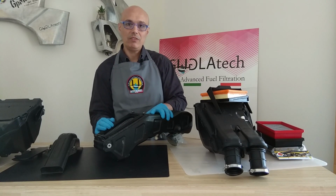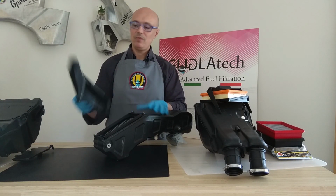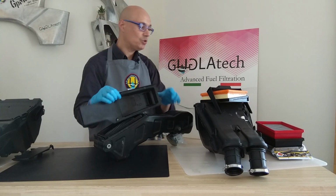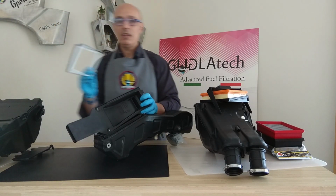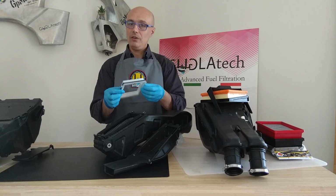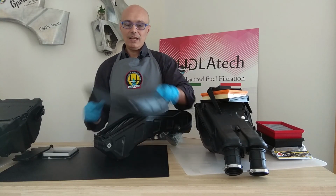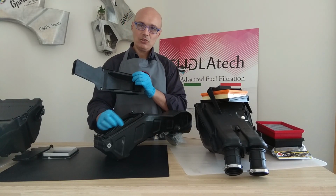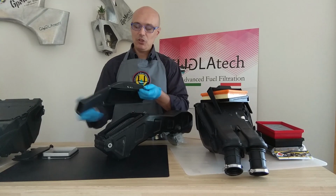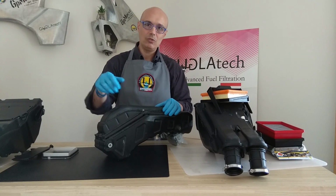One airbox may be with the defect, another airbox may not have the defect, so we have to adapt. And so we did a soft compression system, which means we glued a neoprene high-density foam, the one we use for the Africa Twin 1000 CRF Honda frame filter. We use this special foam, which is very robust but also very soft. Gluing it here, we are allowing just the pressure to adapt itself and compress the rubber and our frame against the airbox. So through this, there is an adaptive compression system which will compensate the compression set that you need to close up the lid.